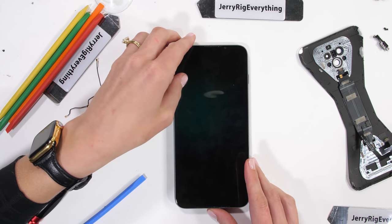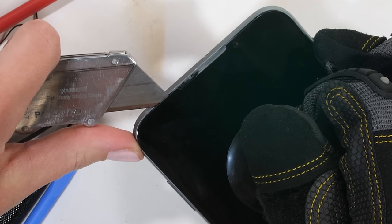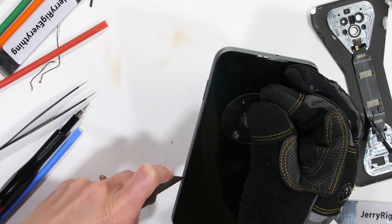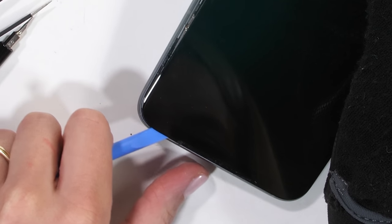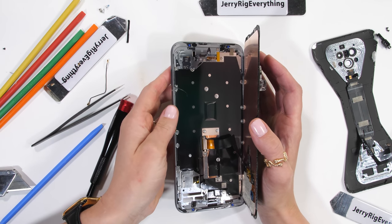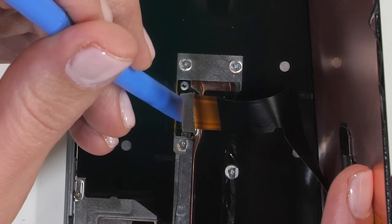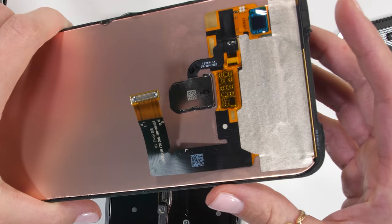This is way more than I signed up for at this point. Gloves are back on and the blow dryer is back, and I might have had help with the initial incision. The tricky part is that if the razor pokes too far into the screen, it can crack the display under the glass, which kills the shark — and if you remember, we're trying to avoid that. The fragile glass on the outside of the screen is stronger than the display underneath, so I'm keeping my razor blade only on the very thin sliver of glass along the edge. There's yet another ribbon cable for the screen guarded by a metal plate — smaller this time with just one screw. Like a little Lego. And the screen is off, with its pretty copper backing and built-in fingerprint scanner.